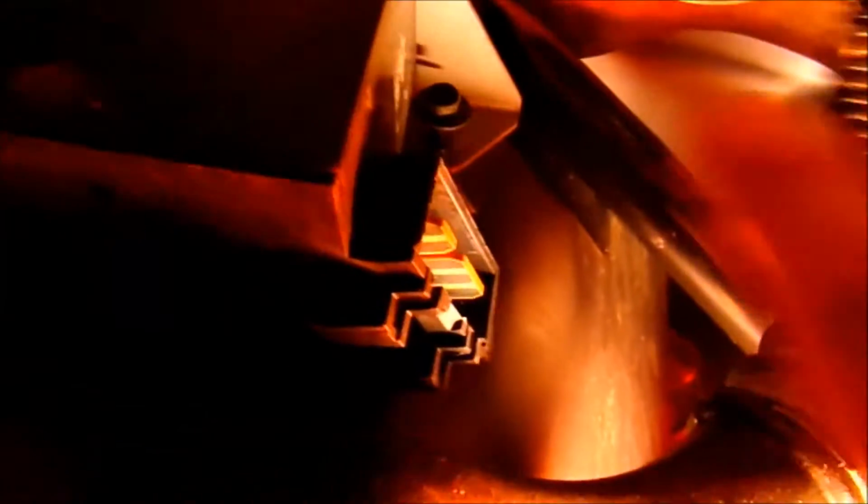Okay, the next thing that I'm pulling out, this is a 7mm. This is your motor that controls your door. It's hard to see up in there. Well, you can see it right there. It should just pop right out of that. Should be able to drop this down and out of the way, and then you've got your rod that goes in and controls your door. I'll take this off before I can get to the upper bolt on the brace.